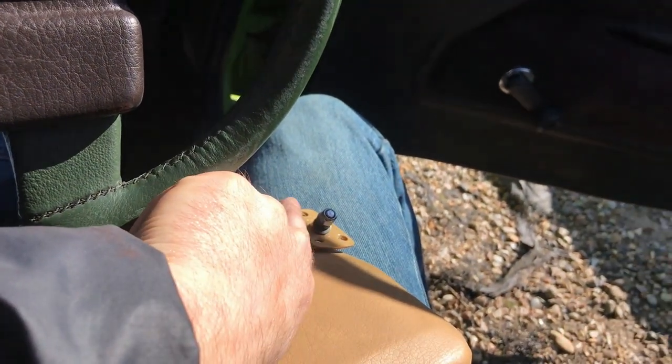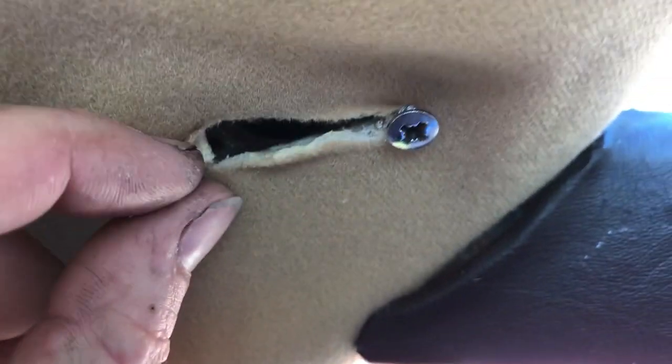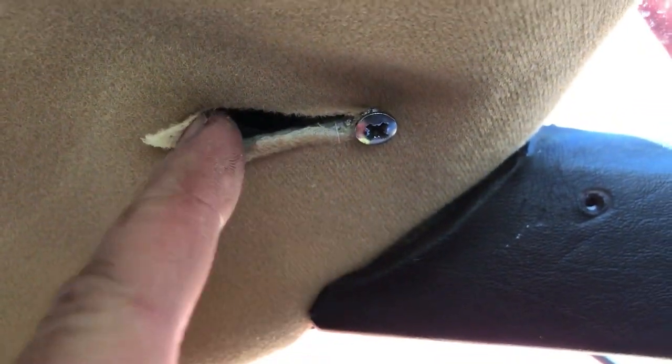Another scary job: fitting sun visors. There's a dirty mark where I've been poking it. There's a cutout in the fiberglass backing where the bolt bit goes, and around there you've got three holes. I'm going to cut that out so I can see where the screw holes are and make tiny incisions for them. What you have to do is cut a slot, then excavate with a drill until you can just see the captive threads in there, then push a screw in to hold it, and find the next one. It's quite scary.